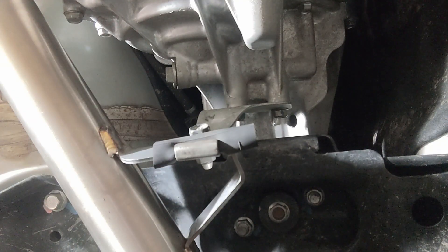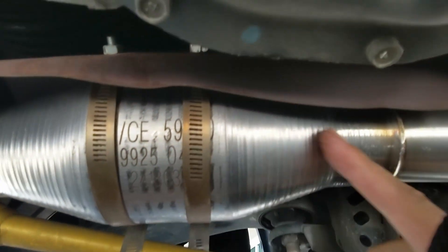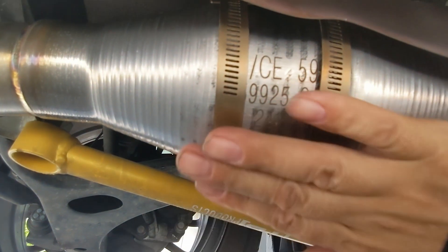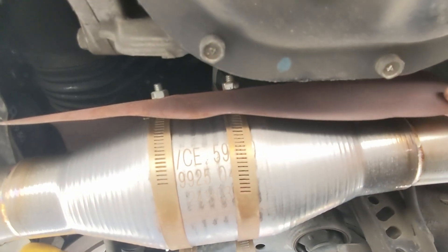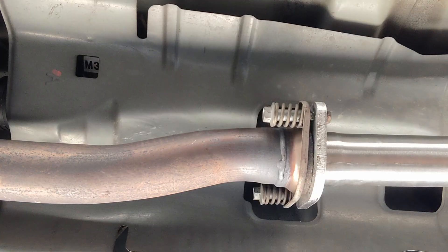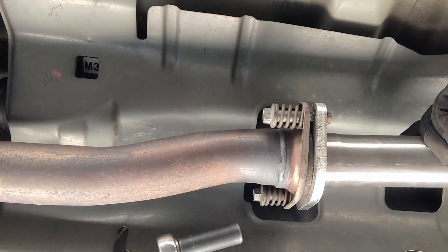That boot there is going to get melted if it gets too hot down here. The exhaust shield should help. I really just want to cover this cat area because this is the restrictive part — when the flow comes in here it's going to slow down and get hot, which transfers right into this case. That's why I originally put this heat shield in. The last thing to do is tighten up these two bolts.